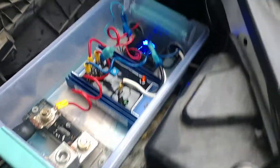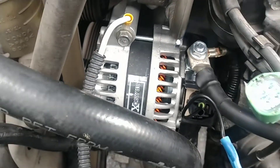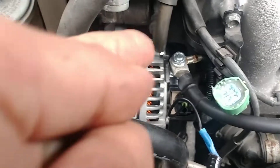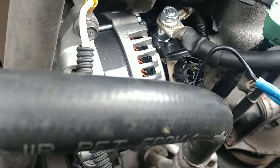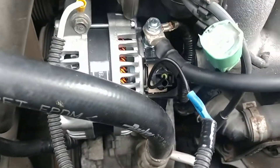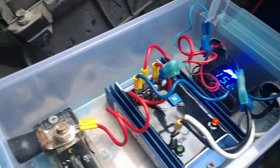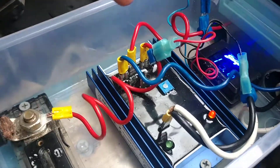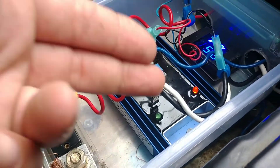Hopefully this will last a long time. I gotta say it's a nicer fit as far as where the power stud is. Here's the factory belt — it's got the automatic tensioner. This car only came with one wire so I grounded it. Pretty self-explanatory: I grounded the regulator to the alternator. It's a field wire, the constant, the remote, and the ground.